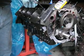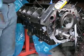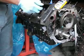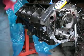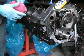That one went in pretty good. The instructions with ARP say to do it hand tight only — that's about as much as I give it. I just make sure it's bottomed out, and that's just my own preference. Then what you're going to have is seepage of the extra Loctite come up right here.